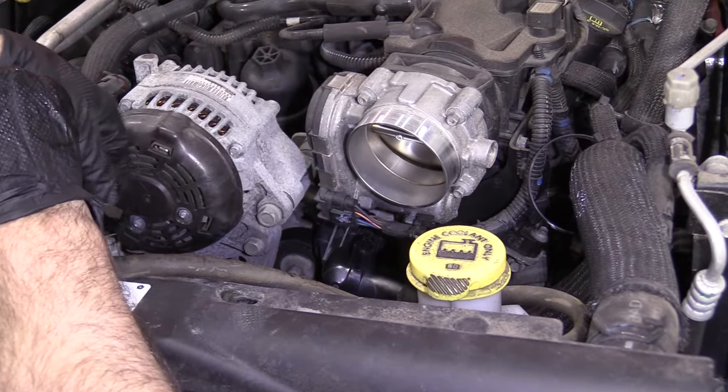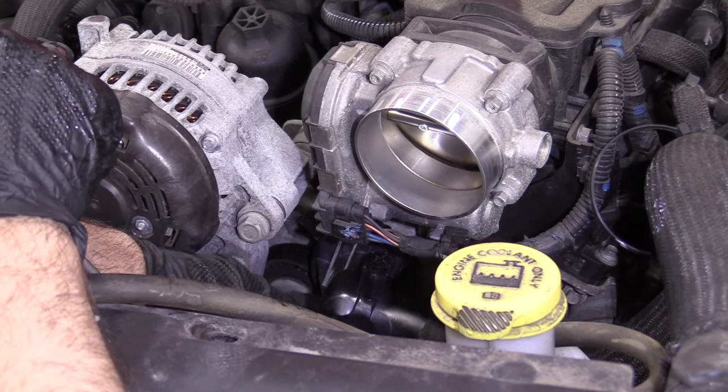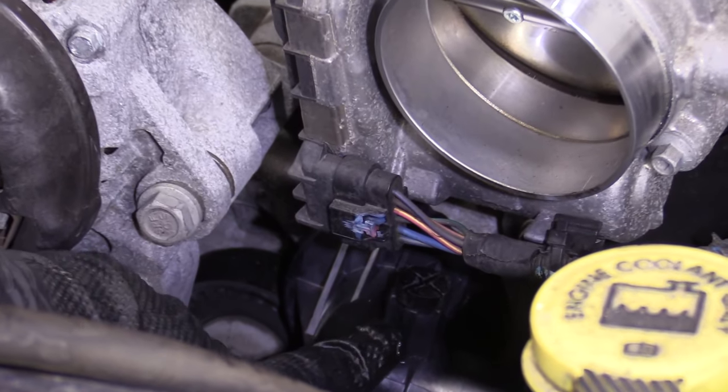Take the coolant reservoir — there's a little tab that it's going to slide into. On the backside right here, it's going to slide on the hole where the fan shroud is. Line that up, then take this hose and put that on the top of the radiator. I'm just going to push this push retainer back in — line that up and lock it in place. Before I put this snorkel on, I want to add coolant — but I can access the bleeder.